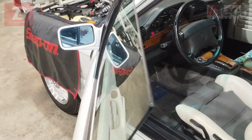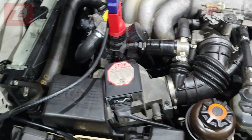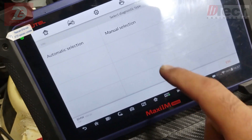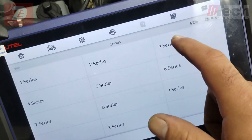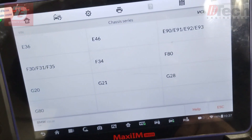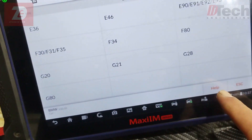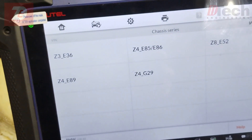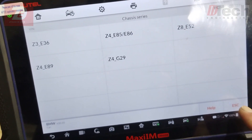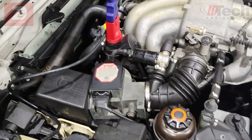That's why I've got my 20-pin adapter on there. It's going to be a long shot to see if we can even read anything. I've got my VCI connected, and my first attempt is with my most expensive tool. I want to manually select because it's probably not going to pick up a VIN. Going into 3-series, we don't even pull up any E30 — it's not even an option. My expensive Autel is unable to pull anything up on this vehicle.